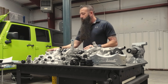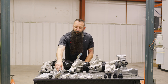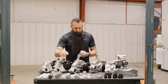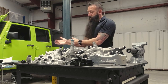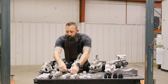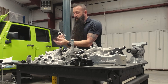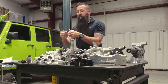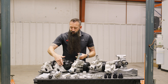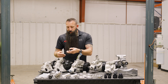If you have a dash one or dash two pump you can always scoot the pump outward with one of our water pump spacers. We have these in a variety of different thicknesses — you can go anywhere from Corvette spacing to a truck-thick spacer. We have the spacers to adapt any of these water pumps, so if it's in dash one or two you can space it out to dash three. On our water pump spacers we use these gaskets — we actually have these made in the U.S. These are a thinner gasket than the factory. If you have one of our spacers, just keep reusing these.